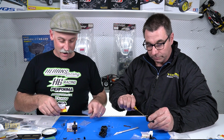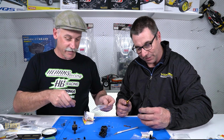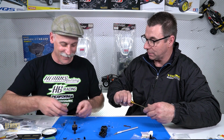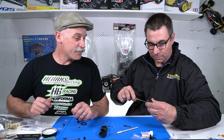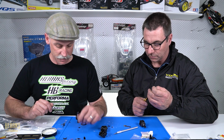It was making a bit of racket actually. It was noisy, and I took it apart and looked at the front one and found the noise. The actual bearing was slightly collapsed, and the pinion was running crooked on the crown. It was just chewed up. So I put brand new ones in there from my stuff. I actually didn't get the chance to maintain that one much.